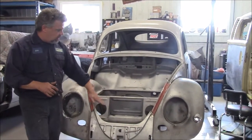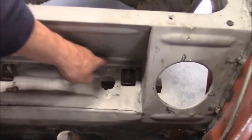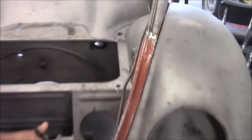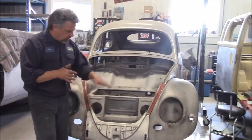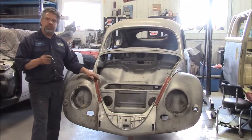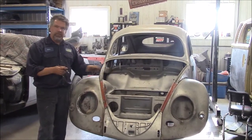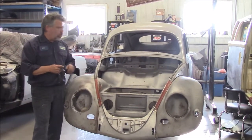Just a brief update — you can see the inside tray. There's still quite a bit of work to do where we have a rod out from where the fluid reservoir sits. We still have to make pieces there and up into where the speedo cable comes through; we haven't done that yet. We wanted to do the bulk of the front nose, the inner fenders, the inner and outer front and rear aprons, and the tray first — because once we have this step done we know everything is lined up properly. Coming up soon we're going to square up the body with tubing to make sure everything is square. We'll be removing the front firewall and the rotted out heater channels, and there's quite a bit of work still to do in the lower storage tray.